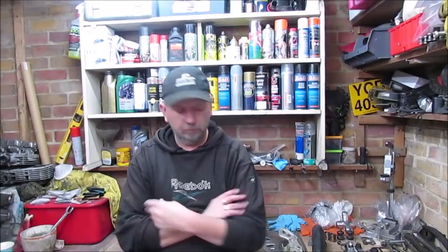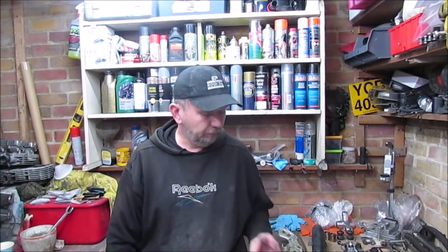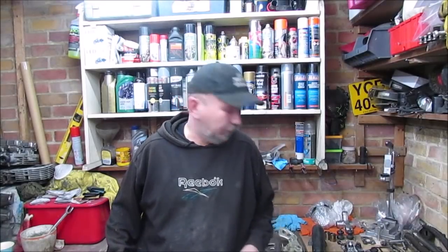Still plenty to go. I've still managed to do a little bit more on the swing arm during the week, but very small. I was speaking to a friend of mine who asked how I was getting off the anodisation. Well, I've tried paint stripper, it didn't work. Sanding, basically. He said try Mr. Muscle oven cleaner. So I thought, what have I got to lose? During the week I'm going to pick up a can and do a few test bits and see what happens.